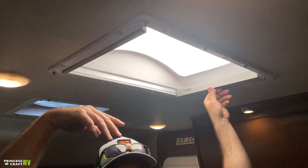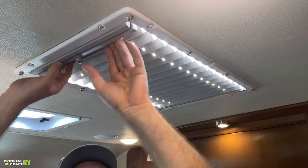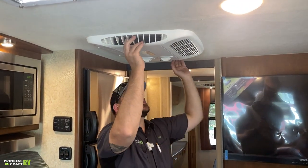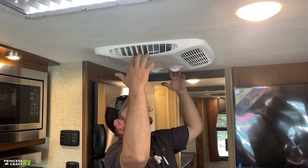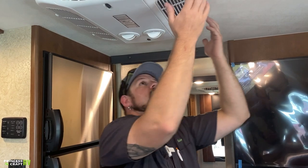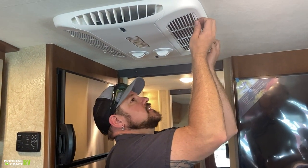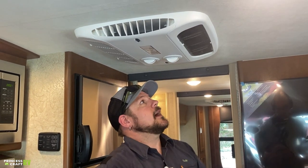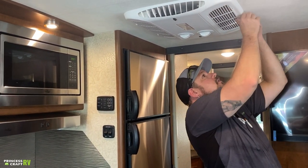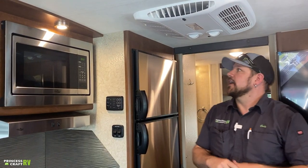There's a big skylight with a shade so you can open and close it — it allows a lot of light in. If you don't want it that bright but don't want the four-season shade, just close it up. Overhead is our Coleman air conditioner with vent selections on the ends to control the registers, and two smaller ones that turn straight down. On each side are your return air filters — pluck the two little tabs down, the cover pops out, fish out the filter, clean with warm soapy water, let it dry, put it back in, snap the cover on, and you're back in business.